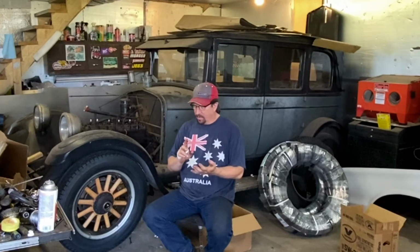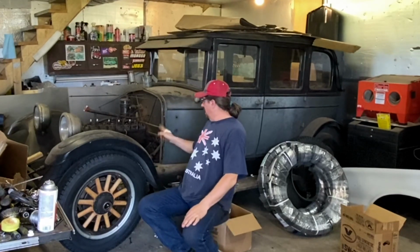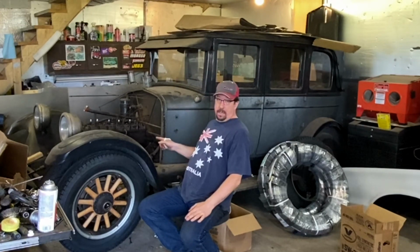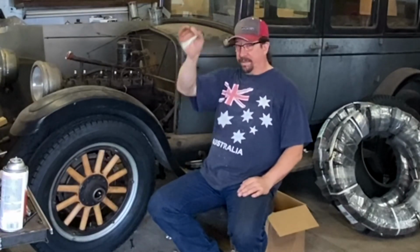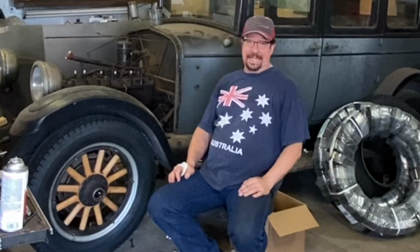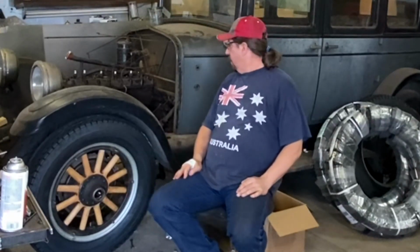So as we've talked before, we need to get the oil pan on, get the screens, all of that. So that'll be the next thing. The other thing I need to do is find out on this engine which is the oil pump out as far as the flow, and which is the return. I suspect that the one line that goes up to the top of the oil filter is the output or the pressure line into the filter, and the bottom one is the return back into the block. That kind of would make sense, that the return line would just come right out of the bottom of the filter, but I need to determine that for sure.